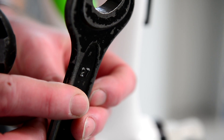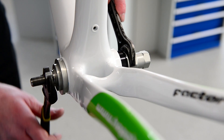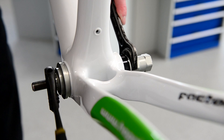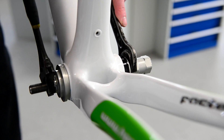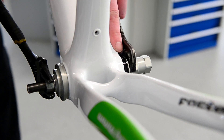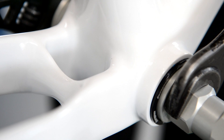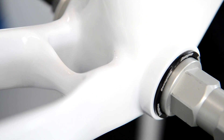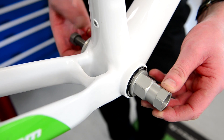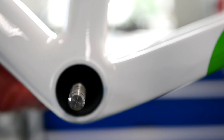Take a 27mm spanner to secure on the edge of the tool, then a pair of adjustables or a spanner to fit the other side, and just gently wind it in. As you're feeling the cup in, you'll feel the faces meet — don't go cranking it right up trying to crush the cup. You generally get a feel for when it touches the edges, and that's all you need to do. Then wind the nut off to remove your washer and tool end.